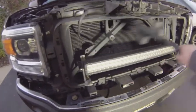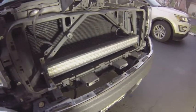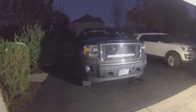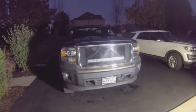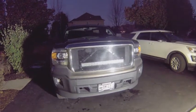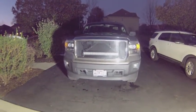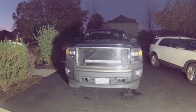Cutting that piece off also frees up a ton of room to mount another light bar right up there — I think that's my game plan, maybe taking advantage of these mounting bolts. But that's in due time; tonight is just about the grill. We ran out of light so you're getting a crappy view, but everything's installed. When you put the backing back on, there's weather stripping on there — make sure it's tucked in properly. I had to take the grill off and redo it because some weather stripping got caught, so take your time and keep an eye out for that.